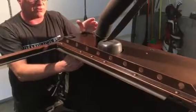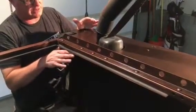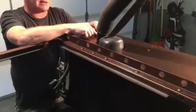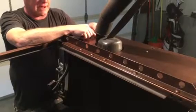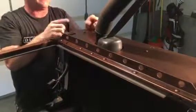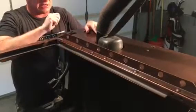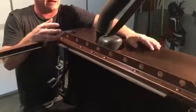From a 2011 to present, with the plastic walls in place, these are going to be very hard to get to. You'll need either a small ratchet, a ratcheting dog bone wrench, or a long 7/16th wrench. You might only get a quarter of a turn at a time, but you will end up getting it tight.